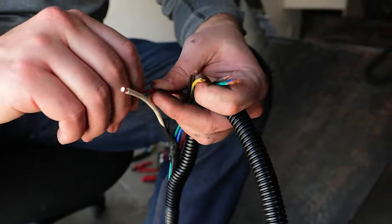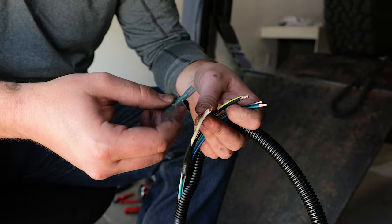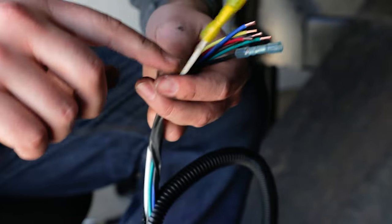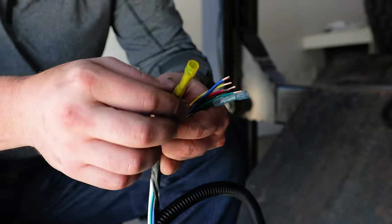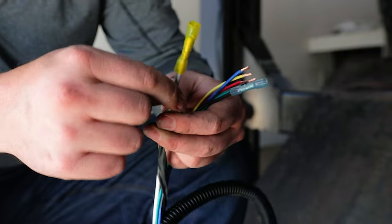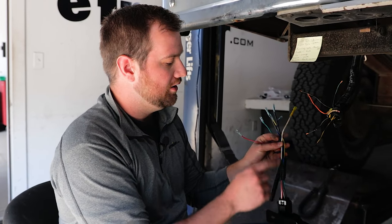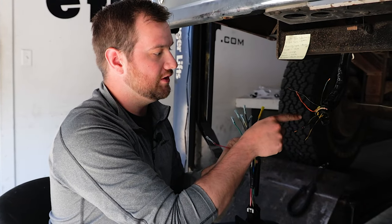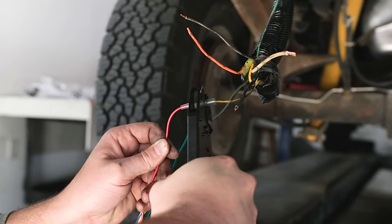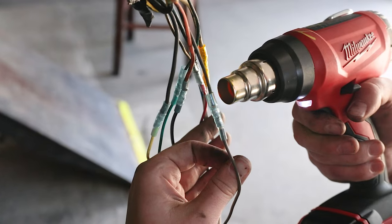With all our wires stripped back we're going to put on our butt connectors. I highly recommend using heat shrink butt connectors because these connections are outside the vehicle and exposed to the elements — they really help with corrosion and keeping moisture out. Depending on your setup, our ground wire already runs up to the frame with a solid ground so we can just connect it with a butt connector, but you may need to leave the white wire longer to run it up to the frame and ground it with a ring terminal. Now we match up the functions on our wiring harness to the vehicle side using what we've written on our sheet of paper. Always give it a little tug to make sure the wire won't come out, then make the heat shrink connections.